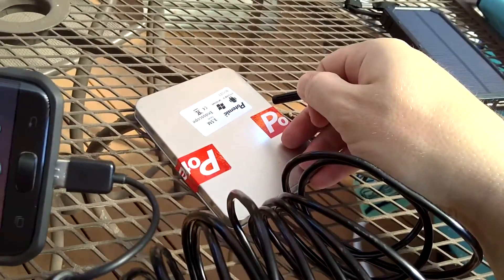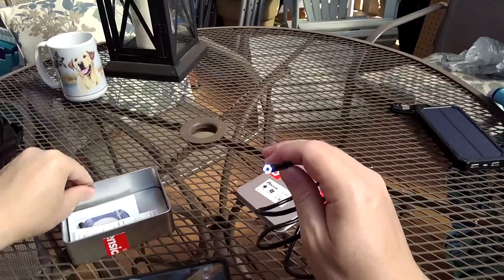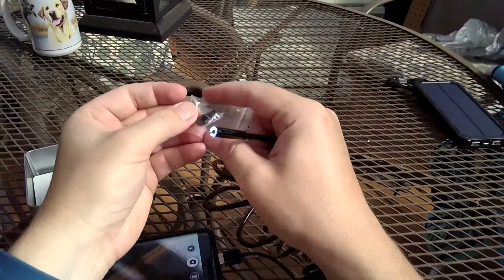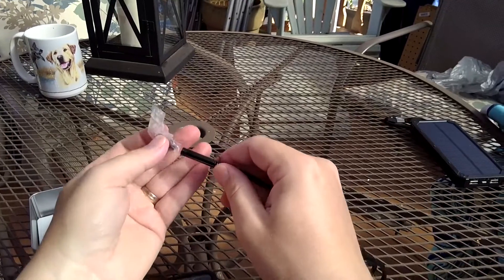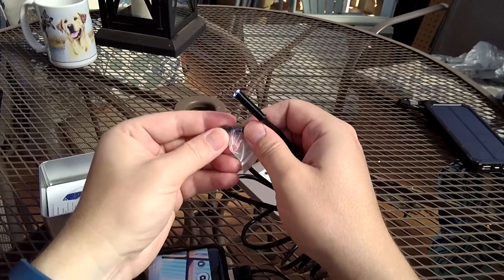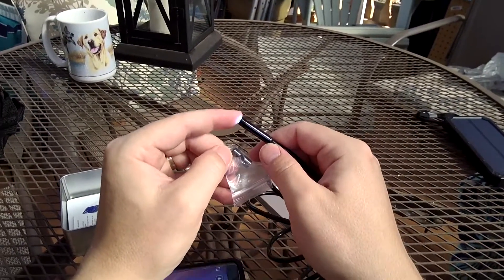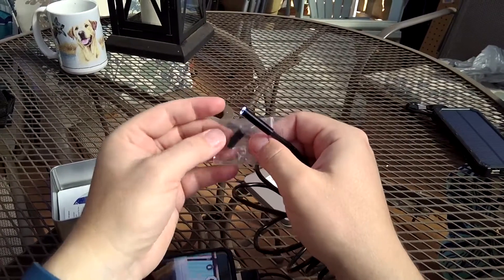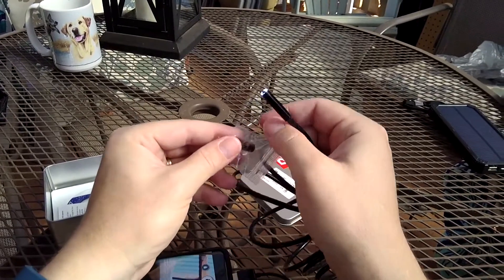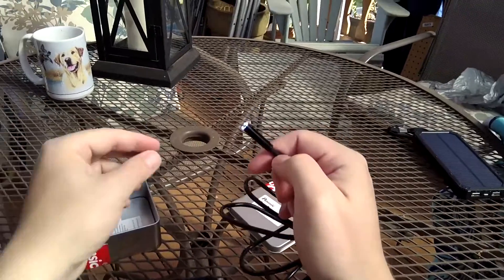There are some accessories it comes with — in particular, one accessory with a mirror where you basically screw on the endoscope. The idea is that you'd record what's on this little mirror so that you wouldn't be recording on a front face, you'd be recording on a side face. I actually had mixed results with that — it was OK, however the mirror had to be really clean and even then it was a little bit blurry. So I actually recommend just using the endoscope without the adapter.